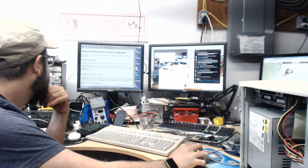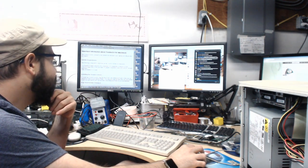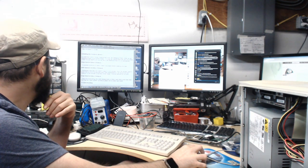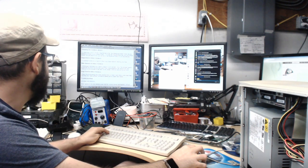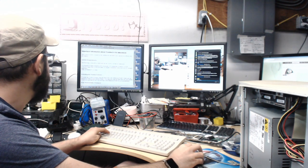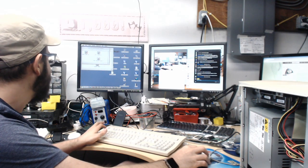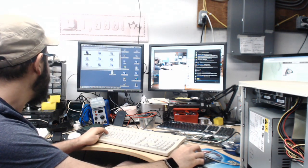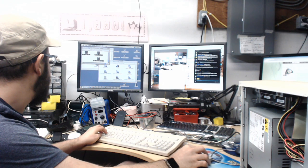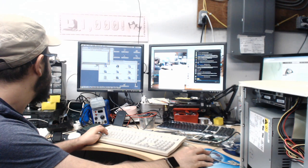Alright, so you need a Voodoo card, a Voodoo2 card. iMac cards are not supported. That's fine. This isn't the iMac card. Alright, problems with OS 9. Well, thankfully we're not running OS 9. Alright, so into extensions folder. Well, here we go. Let's view this as a list, make sure we're selecting everything. Come on.